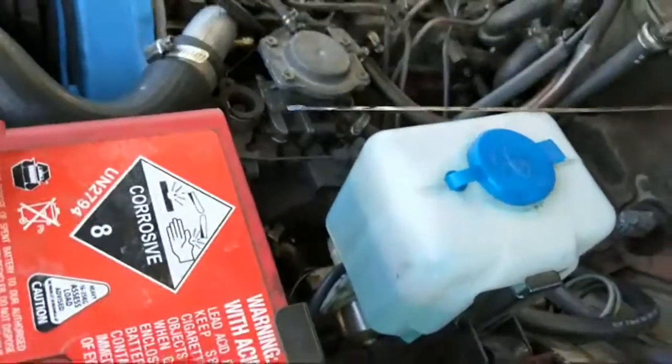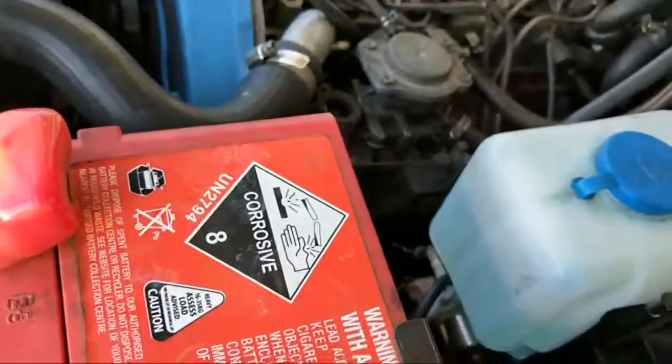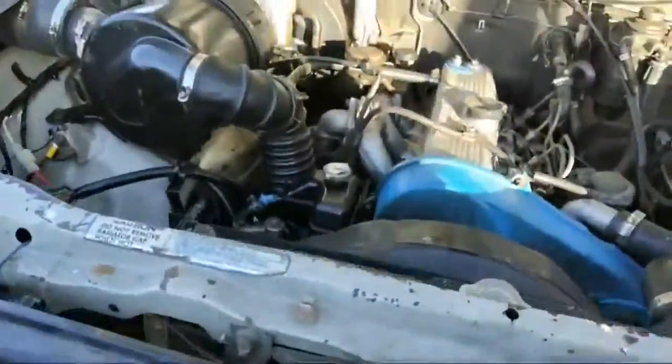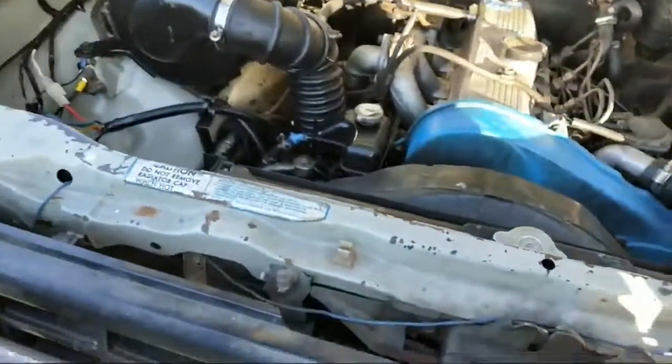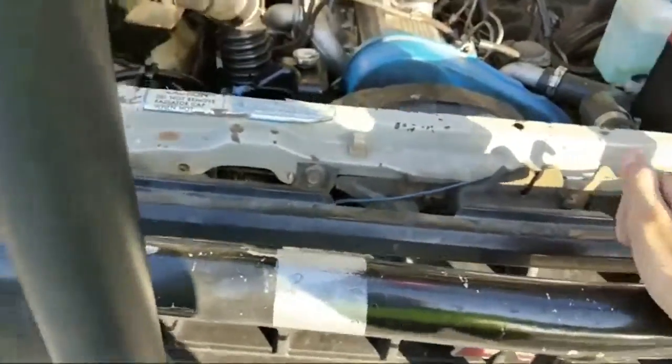So that tells me that I should go with the lower number, not the higher number, because it's been sitting in the oil and it sits on an angle, so there's a potential that the surface closest to the oil is going to get hit first. So I'm looking for the lower number to verify.